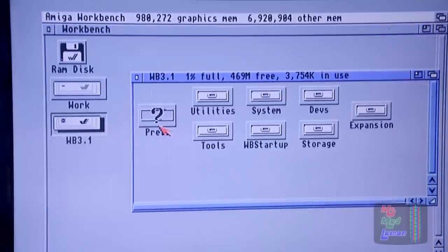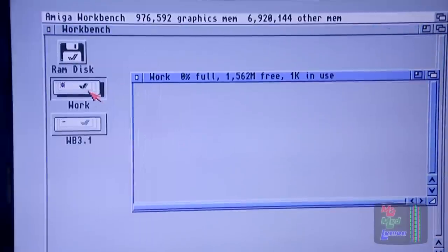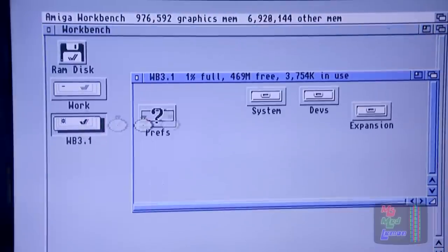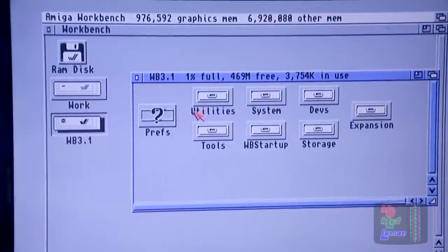The main boot partition is roughly 500 megs, and then the rest of the drive is, what, 1.5 gig? Where's the other 16 gig going? Okay, so there is one problem with doing it automatically like this. I'm not sure if it's actually used the entirety of the compact flash card.